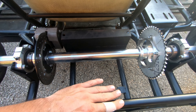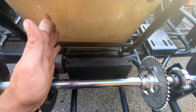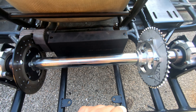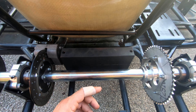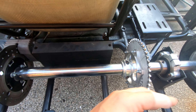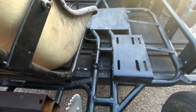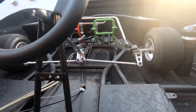So I decided to try mounting the motor over here instead. Take the gas tank off — mount the motor here, boom, torque converter up here — and just run a jackshaft through and over to there. But then I was looking at where the motor sits, where the jackshaft would have to be mounted on the plate, having to step it up and move it back to get everything to line up, and then all the weight would essentially be behind the axle.